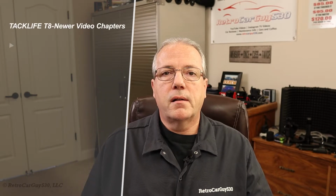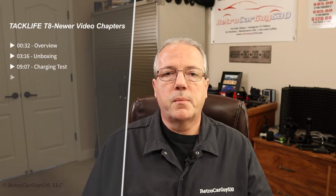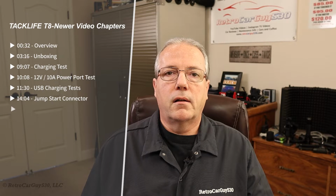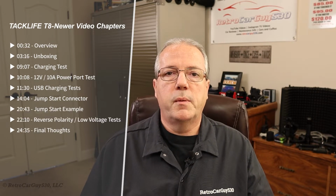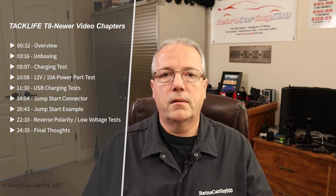A couple of weeks ago, I started my quarterly recharging of the Jumpstart battery packs that we carry in our various vehicles, and when I came across the 2014 Chevrolet Caprice PPV, I noticed that the Jumpstart pack in that vehicle wasn't charging 100%. Plus, when I reviewed the specs of that unit, it had a 500 maximum amp availability during Jumpstart mode, and that vehicle has a 6-liter gas engine and an 800 cold cranking amp battery. This didn't seem like it would be up to the task any longer, so I started researching a replacement.